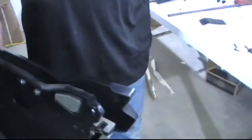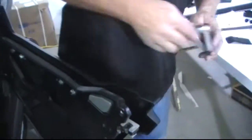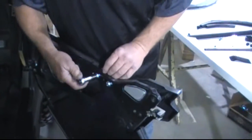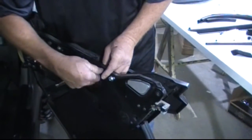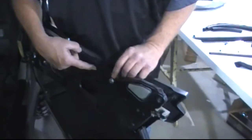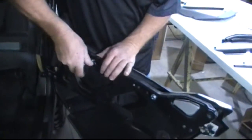That's just to help hold the bracket in there so you can remove the upper door whenever you want in the summertime if you're not using it. Now you can leave the one bolt in opposite of the rivet and take the other one out — that's the mounting bolt. This bolt always stays in with the rivet just to hold the bracket in there. Same thing on the back one.